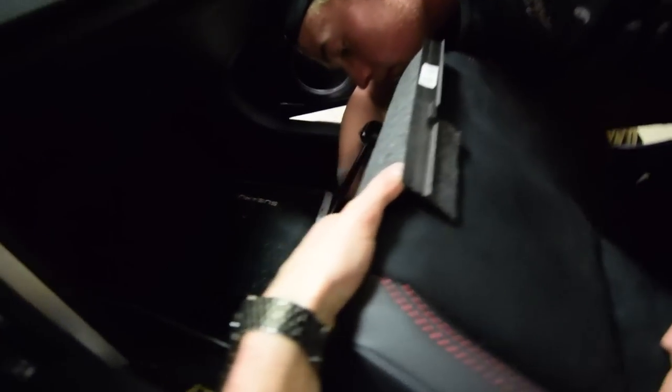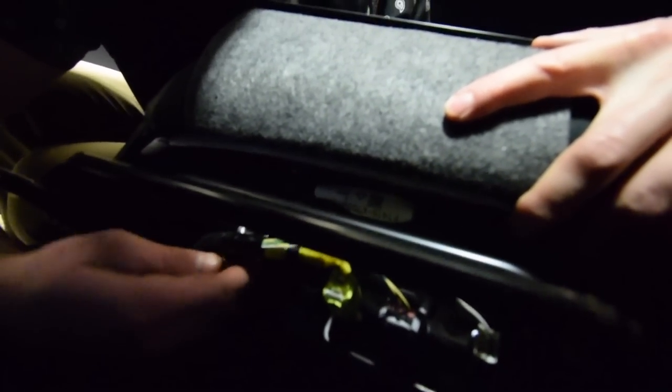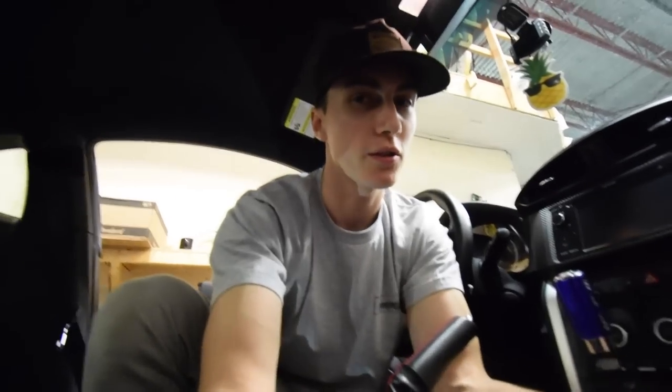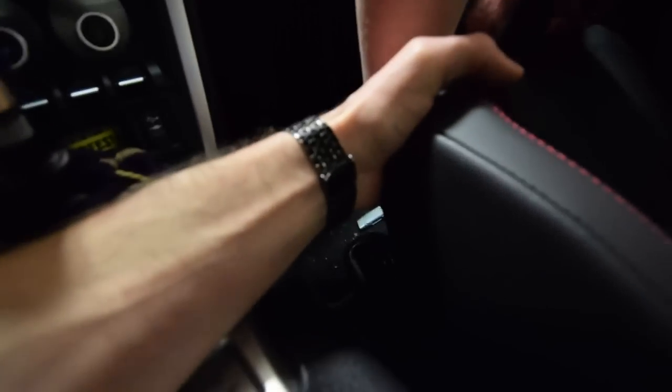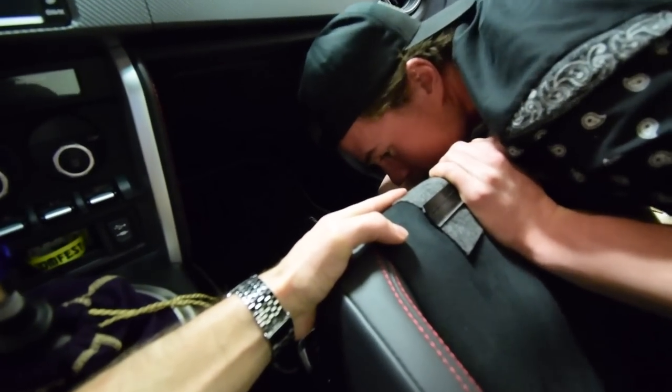So now we have this up. Now you just unplug the wires, and then there's little clips that hold them into the bottom of the seat. Just cut the electrical tape. This is a lot more challenging than I expected it to be. I think the only seats I've ever taken out are on older cars, and that's probably the issue. Even when we took out the 240 seats the other day, there was no cables, no nothing, no stupid Torx bits — just regular bolts and the seats popped out.